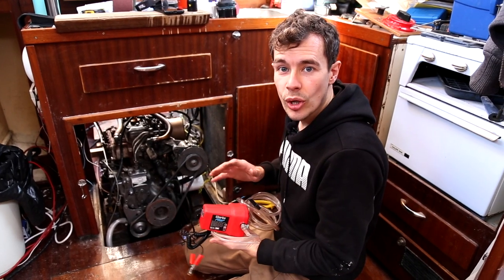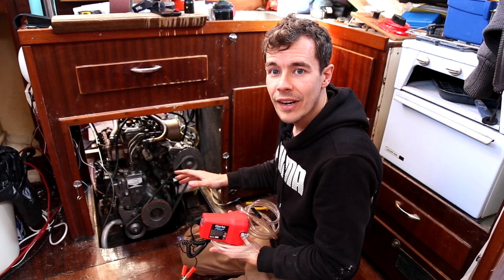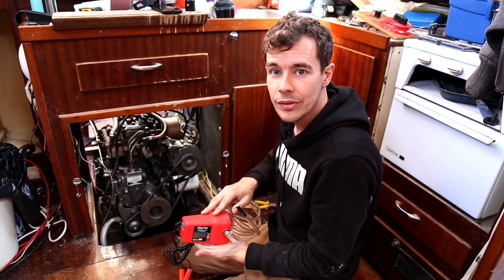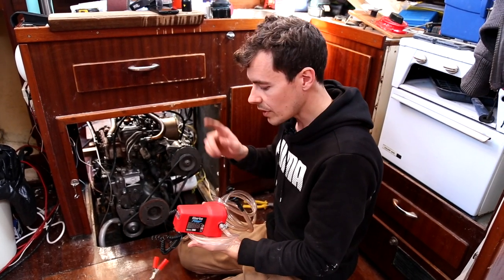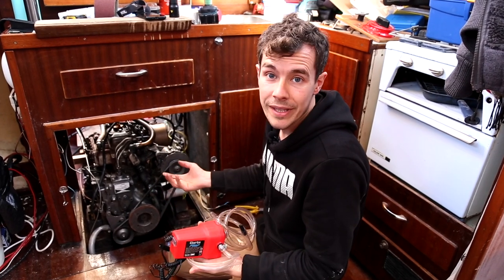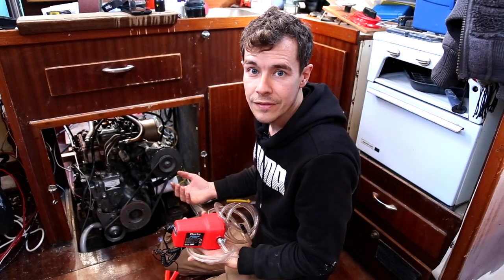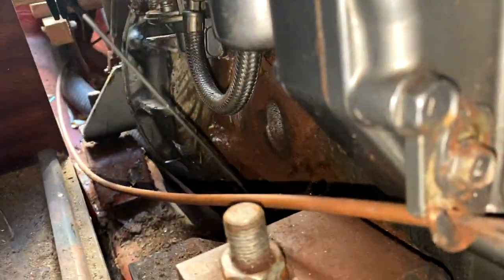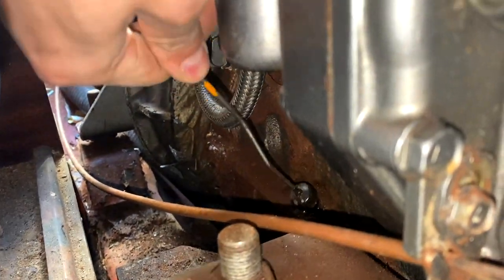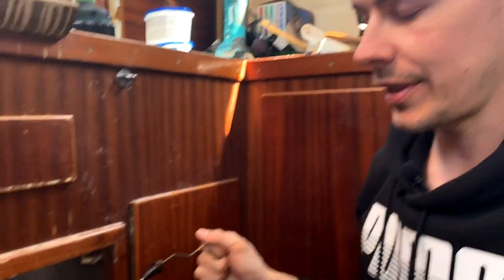Next I'm going to attempt to drain the oil. The engine is cold so the oil is going to be very sludgy, but I'm going to try my best to suck out the oil through the dipstick hole using this pump. I know once the engine's out we can just undo the cap at the bottom of the sump and all the oil will pour out that way — that will be the easier way. But as the engine is full of oil at the moment, I want to try and get as much out as possible so it's a little bit lighter to lift. Look at that — it is absolutely full of oil. Let's try and get some of that out.